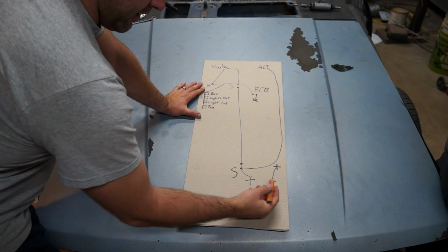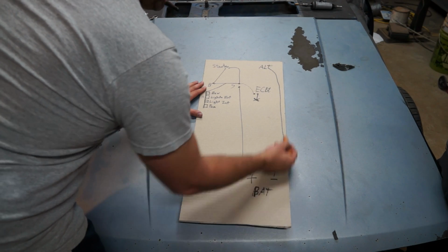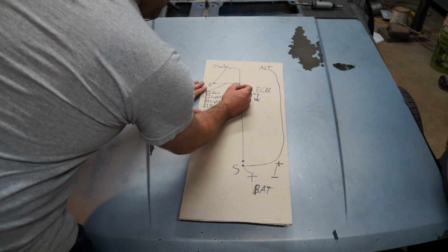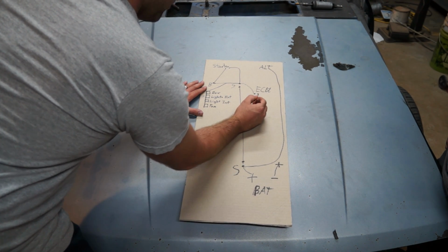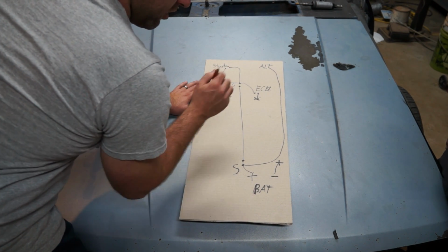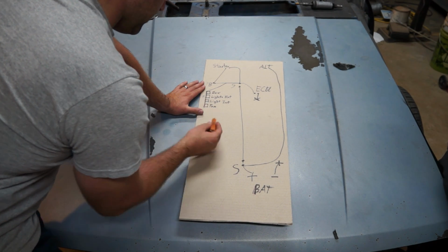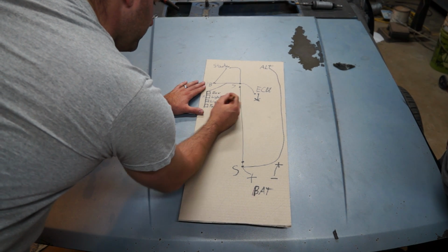The power wire, right? Battery negative, battery main switch, wire from the back side to the alternator, so that it can be cut off from the rest of the car. Power wire from switch to other main switch. Power wire to the ECU, ground wire from ECU. Power wire direct to the starter. Starter push button start right here. It's push a button, PB for that. Power wire feeding a board of switches. ECU can just be a switch. I think it's internally relayed.